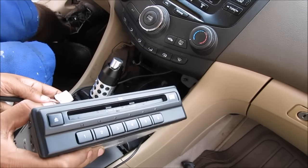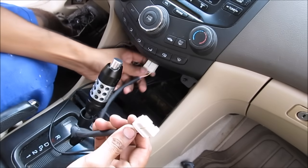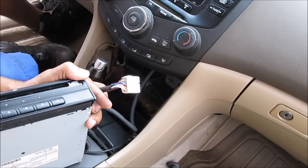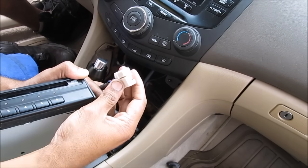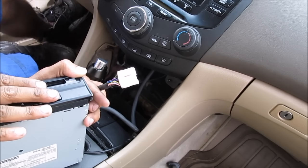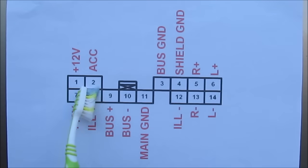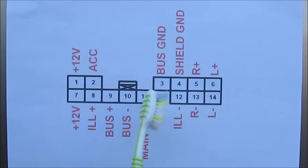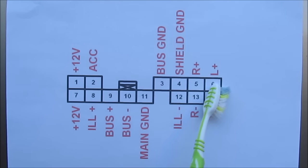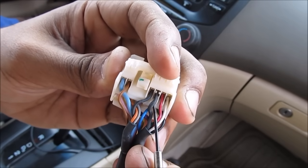The second way to get an auxiliary input is to hack into the CD changer or any 14-pin Honda accessory device that connects to the radio. This 14-pin connector is meant to connect to any external cassette players or CD changer — it connects underneath the radio and gives you a 14-pin out. My CD changer isn't exactly working properly, so I'm going to hack into this 14-pin connector and add my auxiliary line, then connect the CD changer to fool the radio into thinking there is a device attached. Here's the pinout for that 14-pin connector: on the left side are your power wires, then bus wires to control your CD changer, ground wires, and then your left and right wires. What we need to tap into is the right plus, left plus, and shielded ground wires.